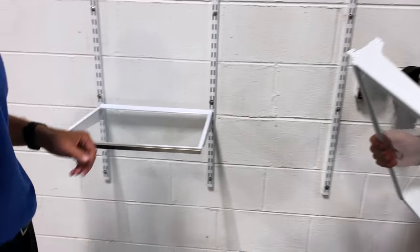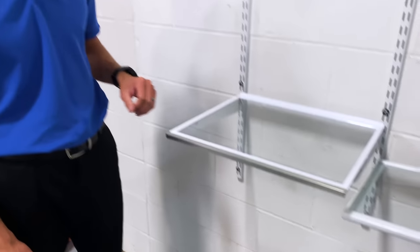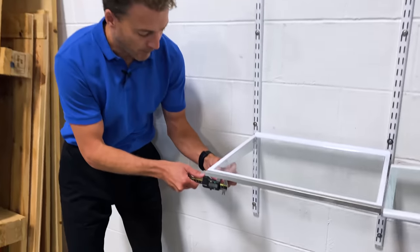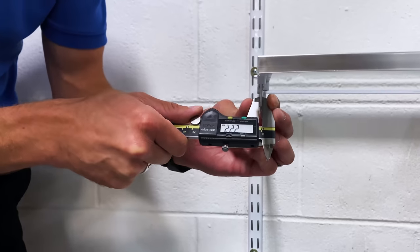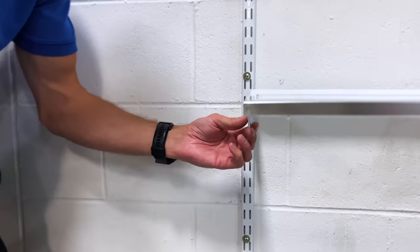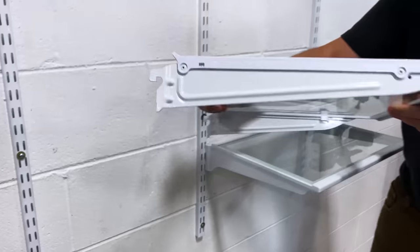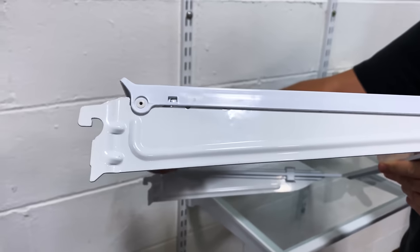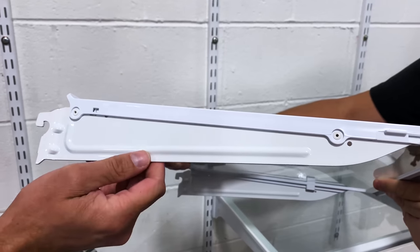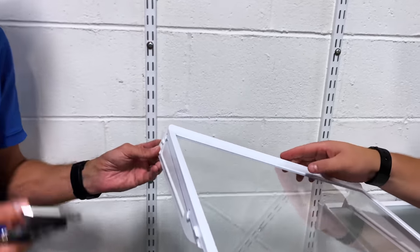The Frigidaire actually is quite more impressive. I think it's better designed. There's a few factors that they accounted for when designing the mechanical strength aspect of it. The thickness of the Frigidaire bracket is 2.25. I thought it was thicker than that. Maybe I measured the wrong point. Now it's 2.25, it's the same, but they stamped in features, gussets, to increase the cross-sectional width of the structure. So when you're doing beam bending, if you add gussets like this, it makes the body of the arm a lot more rigid and distributes stress more evenly through the structure, or it accepts more stress.